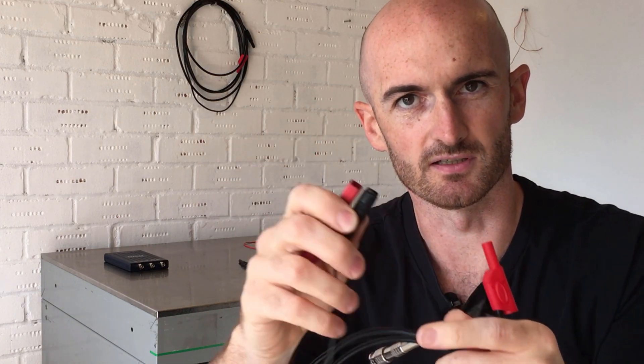This was the big one that got me — inside here, the cables are actually just screwed into the banana four millimeter connector. What happened was this had come loose, so I was getting quite a bad signal. That goes back to the basics of just checking your oscilloscope across the battery before you take any measurements — make sure the connectors are all right. It was no big deal; all I had to do was tighten up the screw in the back of that connector and we were ready to go again. To be honest, there's a similar connection on the PicoScope lead so I wouldn't say they're immune to that problem either. It is nice to be able to take the cable out and reposition it if it gets damaged.